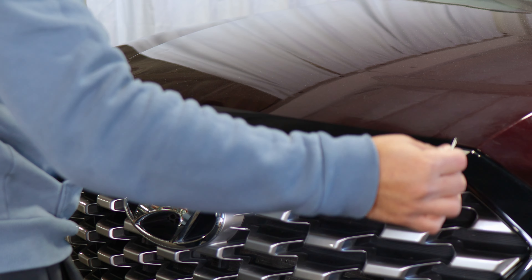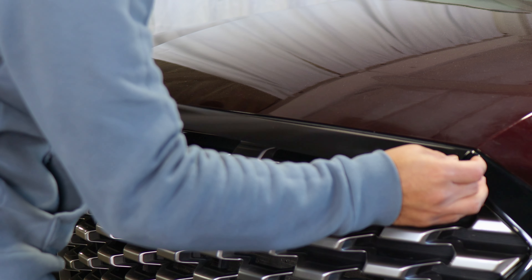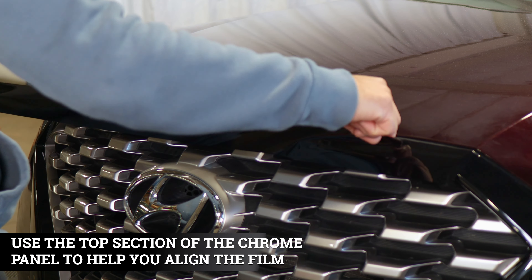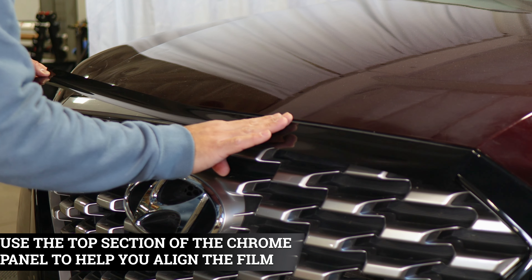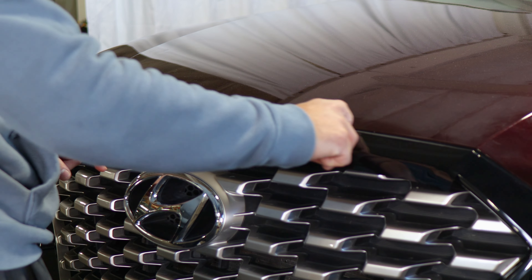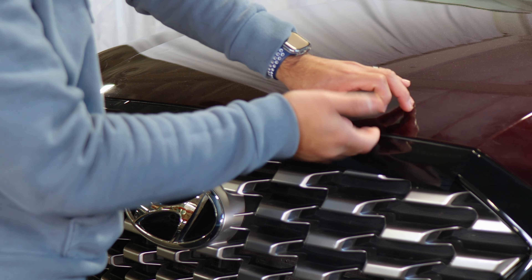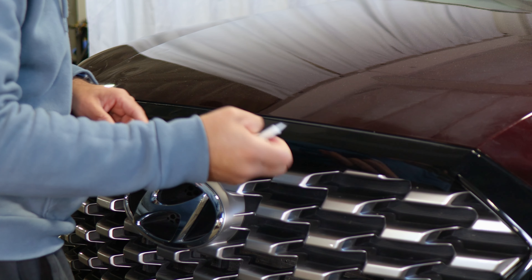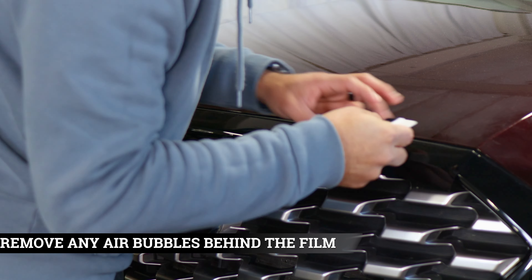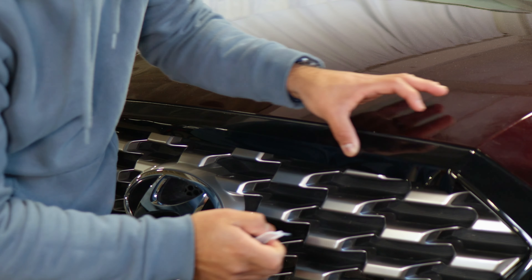For the last piece, align it where we left off — you can start here or on the other side, it doesn't really matter. Just make sure wherever you start you have enough material to cover this side. When aligning, use the top half of the grille as a guide. If you have a little bit of excess material at the top section, that can be tucked in underneath the gasket — lift the hood so you can move the gasket and tuck in the film underneath. Once the film is placed on the grille, grab your squeegee, start tacking it down, and make sure to remove all of the air, including right here in the body line where the grille is located.